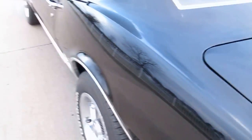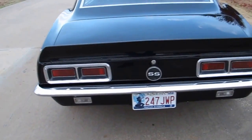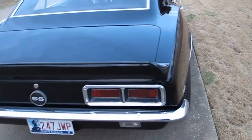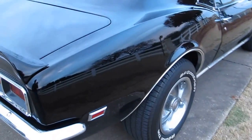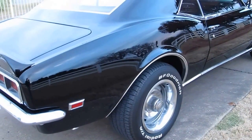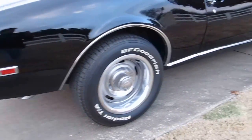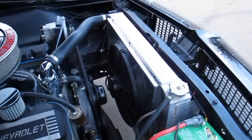Back here is what I'm talking about — you've got the big block, 425 horsepower. It runs on premium pump fuel. It's not too radical that you have to go straight to the racetrack; you can actually drive it around. It is geared low with 3.73 gears in the rear end. It'd be nice if it had one more gear or an overdrive. But you can see how straight this body is — it is super, super straight.